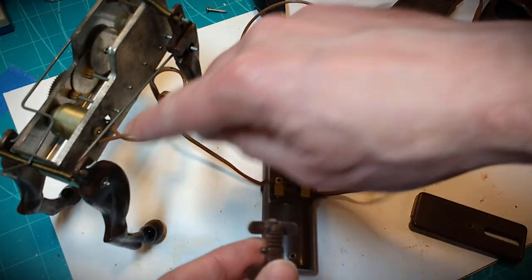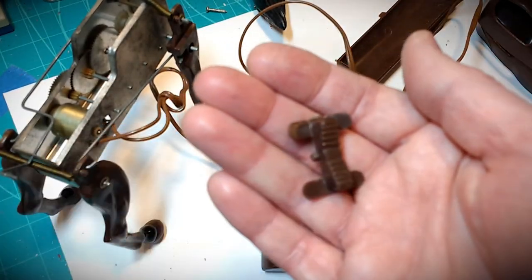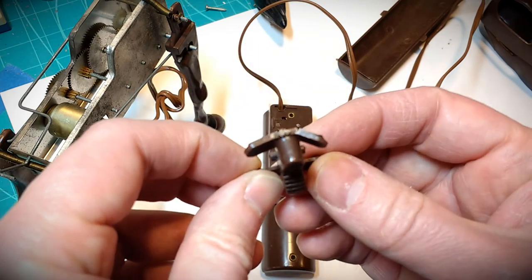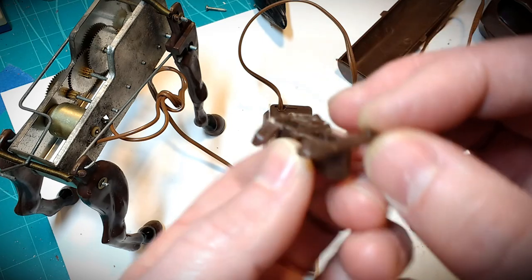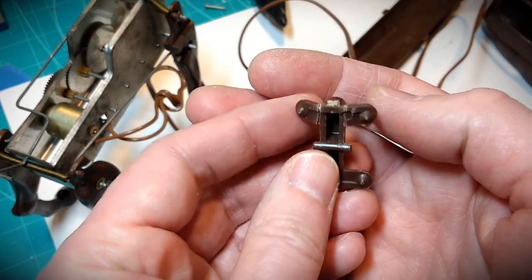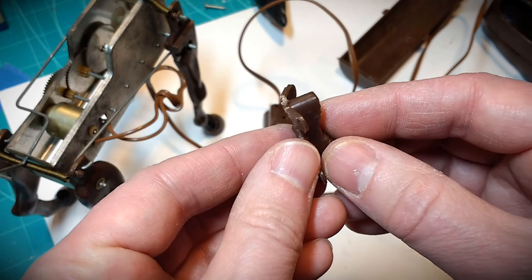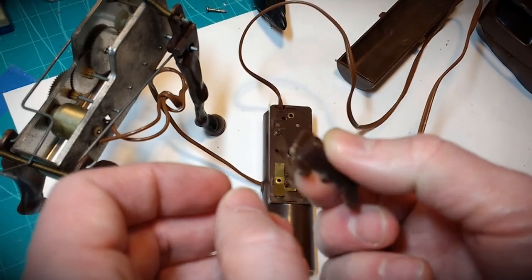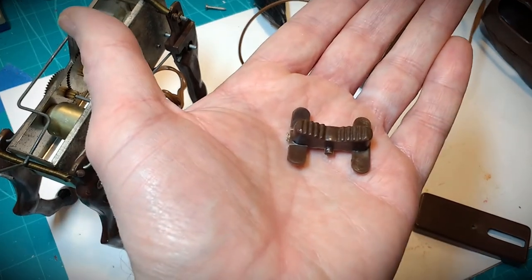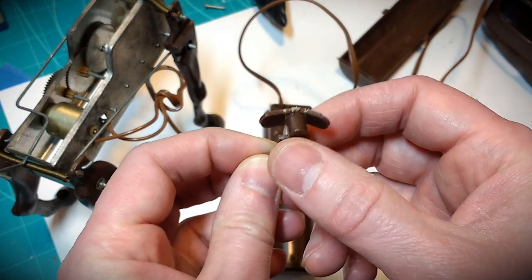This side is really cracked and that one is getting ready to go. Imagine what happens — thinking back as a kid, you're pushing on it, it's not getting the action, so you just push down harder. You don't know it's cracking on the inside. You probably think the batteries are getting weak, so you push harder to try to make that connection until you've stressed it out.